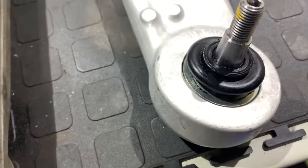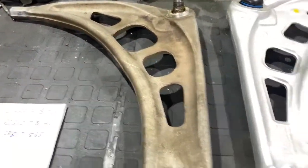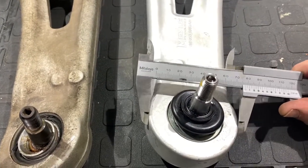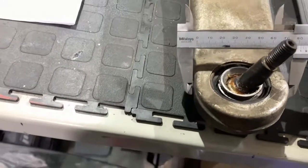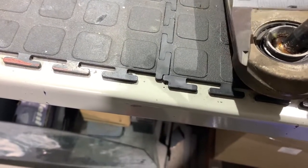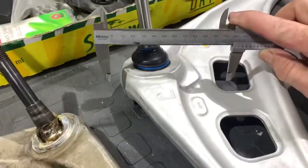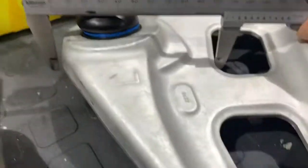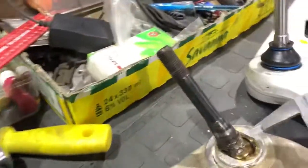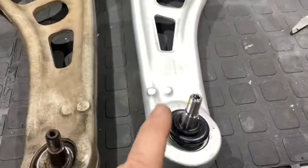They also claim that they make their components beefier, and if we take a vernier to it we'll see that is actually true. Across this rear knuckle end over here, we're at around 77 millimetres, and then across the one that came out it's probably four or five millimetres smaller - about 74 to 75 millimetres. Definitely chunkier. The web diameter measurement is also quite decent at around 11 millimetres compared to this one - without moving the vernier you can see the massive difference. By all accounts this is a beefier product.